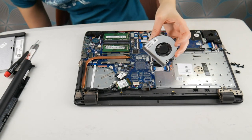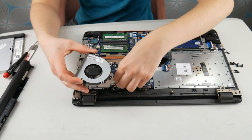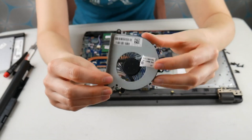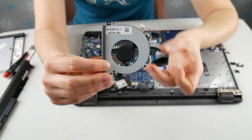That's the first thing to try because it's the cheapest. Then you would plug it back in, turn your computer on, and see if it's still loud. The next thing I would look for after that is sometimes you have little stickers and pieces of tape that are hitting the fan, causing it to make a very loud noise.